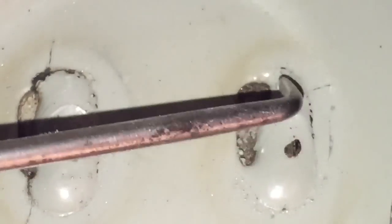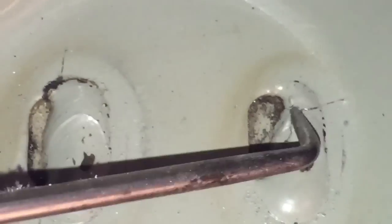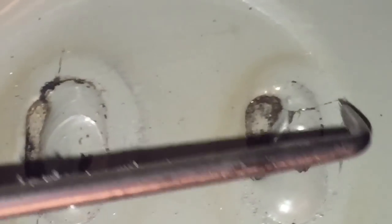Look at that for a factory MIG weld, how much of that gap of the panel, which they cut out for welding, didn't get welded. Gaps down that side, but massive gap down that side. So half of the width is only connected by a MIG weld, and probably partly why it's got a crack going through the top section of it.